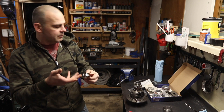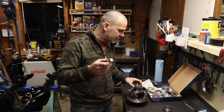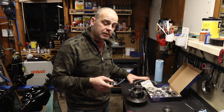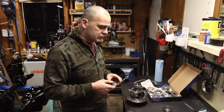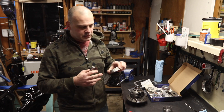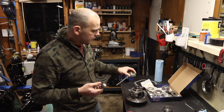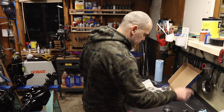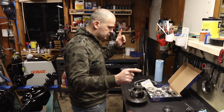This inside race I hogged out with a die grinder, which worked pretty well. But it doesn't have the bearings on it, so that was easier. I might go that way, but then I've got to clean the bearings really well to make sure there are no metal shavings. By using the hone, I'm just getting metal dust that'll come out with solvent — I'm just paranoid about shavings getting stuck in there.